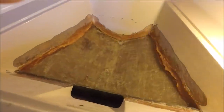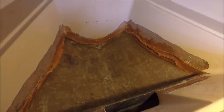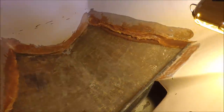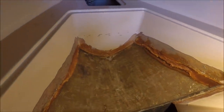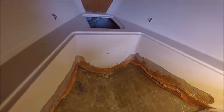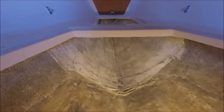There's a large locker here under the bunk with cover boards. It's got a fiberglass pan liner throughout the interior with a lot of hidden space — several inches of dead space behind it, inaccessible. Some of that liner has already been cut out, and we're going to cut more and add stringers and bulkheads where needed to make that locker large and accessible. The top of the locker is about seven inches above the waterline, so we could make these watertight lockers for collision protection.